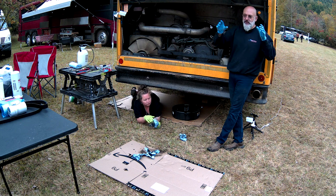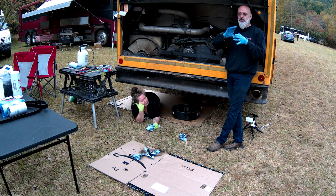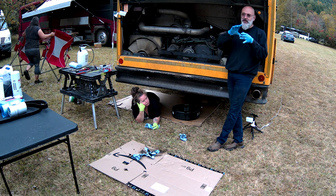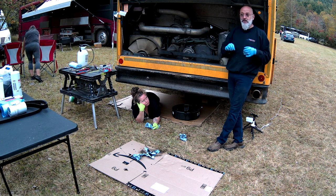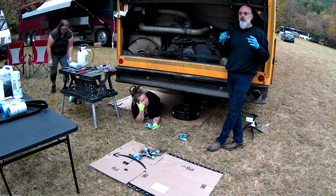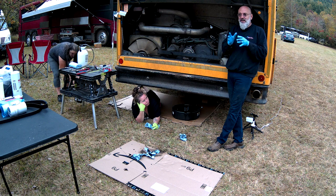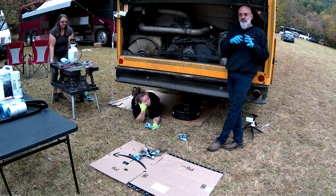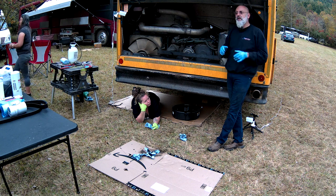We'll say 8 ounces. I forget what the specific amount is, but a certain amount of oil goes through that hole. So a 15, that specific amount of oil would take 15 seconds. A 40 would be 40 seconds. So this is a multi-weight oil. When it's cold, it acts like a 15 weight, so it flows faster. But when it's hot, it protects like a 40 weight oil.